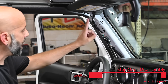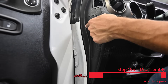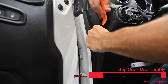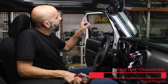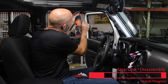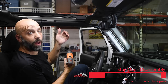This is going to give us a clear channel to route the GPS antenna down through the dash. Taking our panel pry tool, we're going to remove one more piece of plastic from the left side — this panel here — which allows us to route the GPS antenna and the microphone cable down. Push on the panel to get a little access, sneak your tool in without damaging anything, pop the panel out, and move the clips as you go down. Now we're going to remove this piece of plastic so we can run the GPS antenna through this trim. Take your T20 Torx and remove the two lower bolts, and then remove a T20 Torx from here and one more that allow these panels to pop out a little, making GPS antenna routing easier.